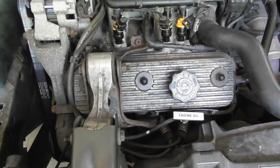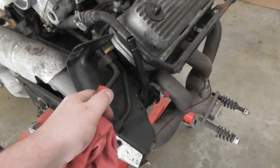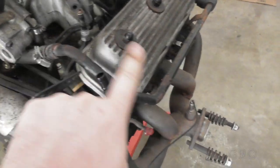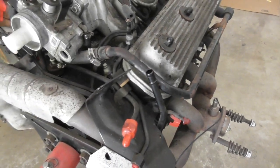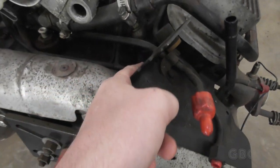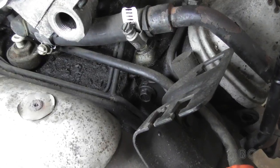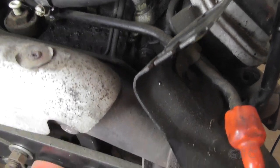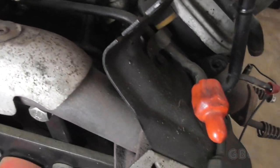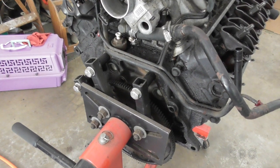Let's get back to pulling this engine apart. I'm going to take the heat shield off and the fuel lines off, and then remove the coolant pipe. Starting to take this apart — there's a bolt back here that's very tricky to get to. In order to get to that, I have to take this section of exhaust off. The exhaust piece came off just fine; I also went ahead and removed both exhaust manifolds, and both valve covers are off as well.